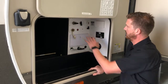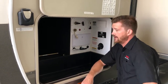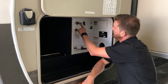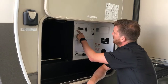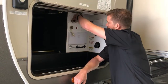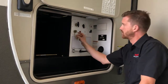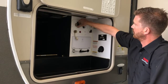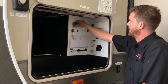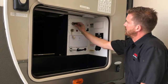Here at the front storage compartment is where you'll find your water system control. With this style of water system you'll fill your fresh tank from the pressurized city water connection. You can hook your water hose right up to here and then there's a fill valve. In the normal position you're pumping water from your fresh tank with the water pump. You can turn that valve to 'city fill tank' to pressure-fill your fresh water holding tank, or turn it to 'fixtures only' to pressurize the water lines. There's also a sanitize/winterize setting for pumping antifreeze through your water lines. For now I'm going to leave this valve in the normal position.